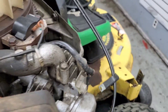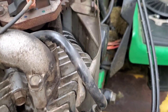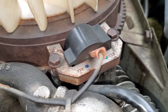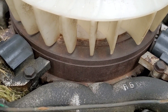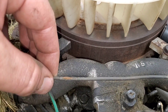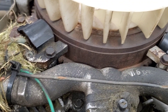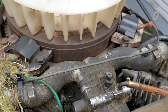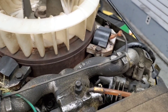Let's check the other one — the other one looks pretty good. So you'll want to make sure that if the wires are chewed through at all, you're going to want to replace that wire. On this one we'll replace the wiring harness between the coils. Sometimes they have a resistor in between the two — that keeps it so when you ground out one, it keeps the other one from continuing to spark. It's basically a one-way kill on those.